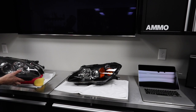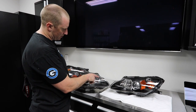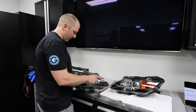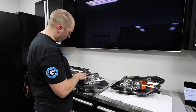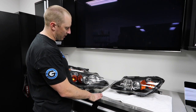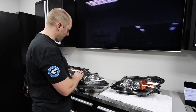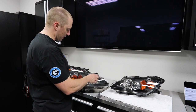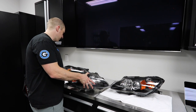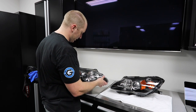See, here's all the issues of the headlight. So this is the original headlight, from the 3M kit, that I wet sanded the heck out of and just couldn't get it out. I don't know why it penetrated so deep. I'm sure I could keep sanding. But anyway, there's lots of stress fracturing in the headlights, which I think is a common problem with these. I think the key was, once you put the tint on there, it doesn't allow them to contract and expand like they normally would. And so this whole thing kind of gets these stress fractures. But the thing's 10 years old, 11 years old, so whatever. Cost me a few $100 to replace. A lot of $100, I should say. But now I'll have brand new headlights in the car.